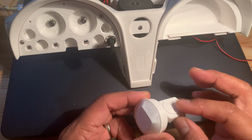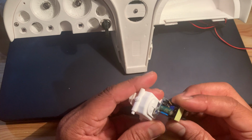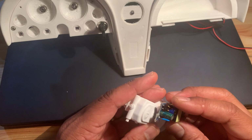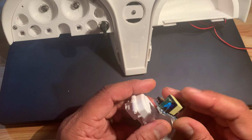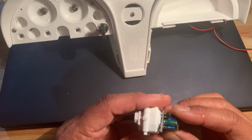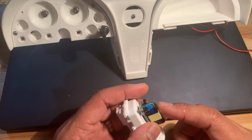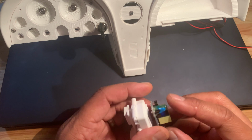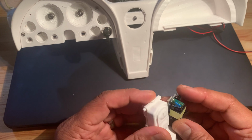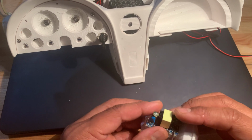is we're hulling, kind of cutting this out or hollowing it out rather. And this will be resting inside this. This is the rectifier circuit. This is what converts AC to DC, the current change, conversion rather. And what I'm doing is connecting the DC charge produced, and I'm going to run it straight to, as it's producing a 12-volt, 1 amp charge coming out of this, and I'm hooking that directly into the radiator fan, so that when the engine's running, it produces the charge to run the radiator. So that will be the next video, next couple of days, hopefully, sometime this weekend.